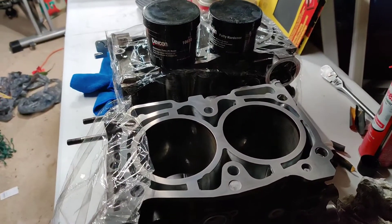So anyway, if you don't quite know what I'm talking about — instead of being a sane human and actually buying an IAG or Outfront closed deck motor — what I'm gonna do is use this aluminum epoxy and fill in these gaps. Obviously you drill holes for coolant passages and for the case bolts. I'll probably fill it up to about a little lower than that, making it a little thicker than what the stock supports are.